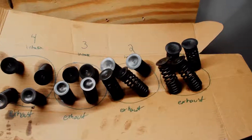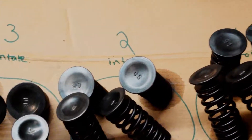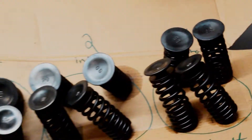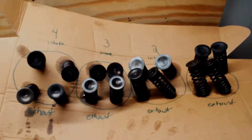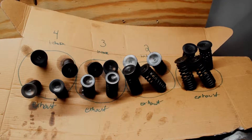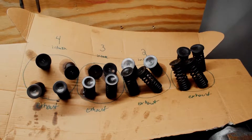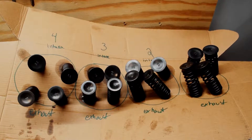That's going to be it for me. Got all my valves cleaned — took quite a while on the bench grinder, but got them all done. Cleaned off all the springs and removed the oil on them too, so we should be looking pretty good. Just got to wait on getting the head back, and then we can go ahead and lap the valves first and then put them back in.